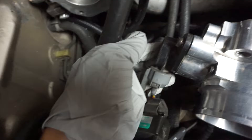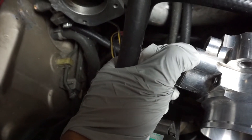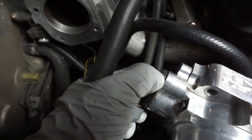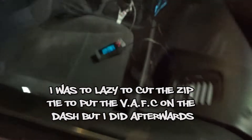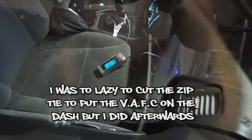So with the throttle positioning, all you want to do is move it slowly back and forth to set this the way you're supposed to. I gotta line it little by little just to see how it is. Now I'm gonna check — right now it's reading 0.535, so I gotta adjust it forward more instead of back.